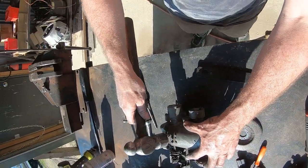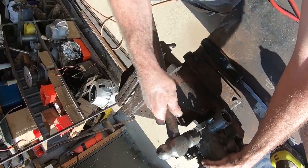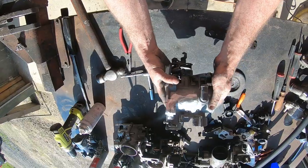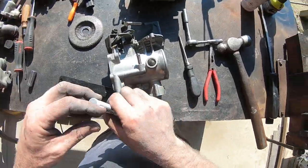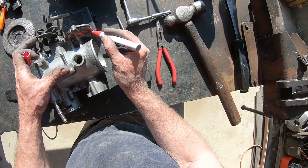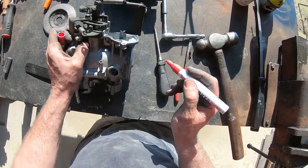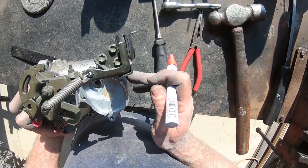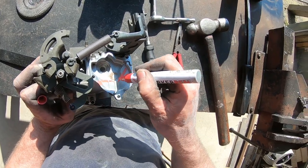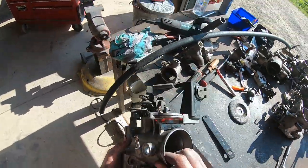I've had a little blanking fitting made up for the vacuum port at the top of the throttle body - I did that on both throttle bodies. The second throttle body had the bottom port blocked off as well. I sanded off the bottom of that bracket that the traction control motor sat into, and I did have to take the throttle bracket off completely to complete that job. We mark it up before sanding so we don't take off more than we really need to.